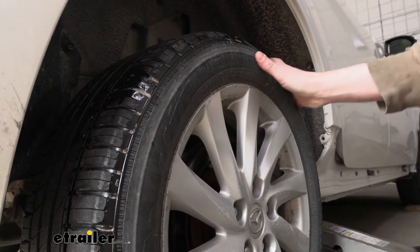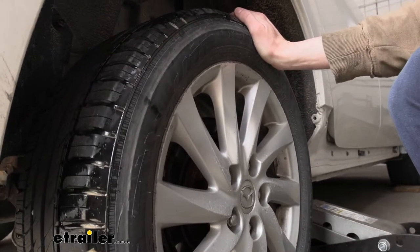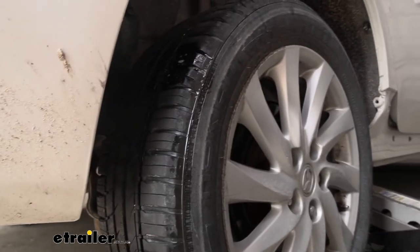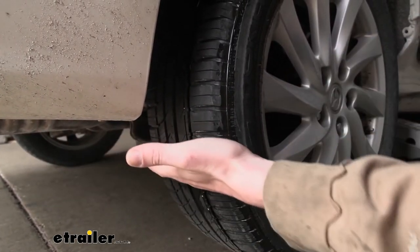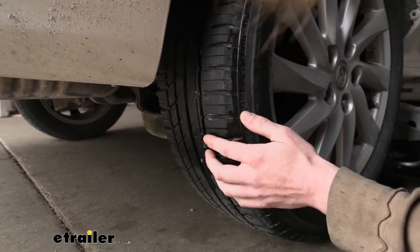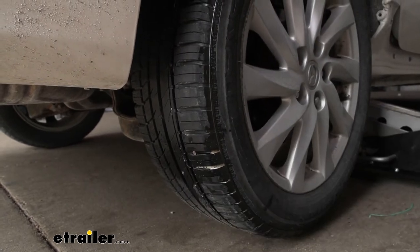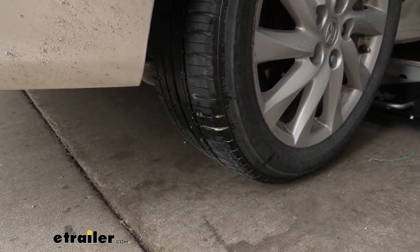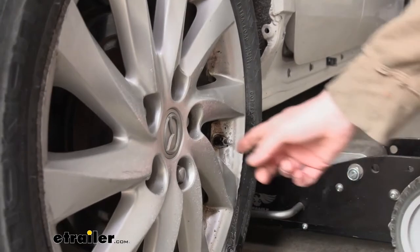The first thing I did is jack it up just so I could rotate the tire. I have my front wheels chalked so the vehicle can't roll, and this gives me the ability to easily move the tire around to find the leak. Now that I've identified the leak at that screw, I'm going to roll the tire down to a position where we can put it back on the ground, because we're going to have to push very hard to get our plug inserted. You'll also want to check your valve stem to make sure it's not leaking — just give it a spray, and take your cap off to check the core in the middle.